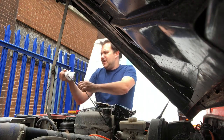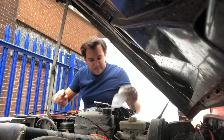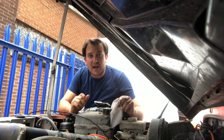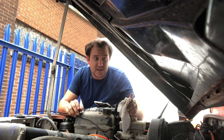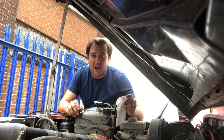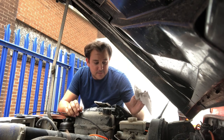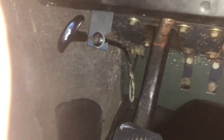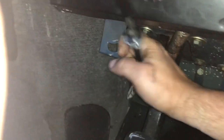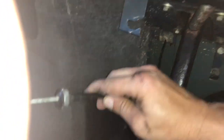That's been sitting in the engine bay for quite a few years now. I want to find out exactly where mine failed because the cable is coming through and I suspect it might actually be at the handle side inside the cab. I've loosened this off now — the pump pliers didn't fit in there at all so I ended up using a spanner on it. Now I just need to pull it out — it just slides straight out. You can see the lock nut there and the washer that it sits against, and I can pull my cable all the way through.